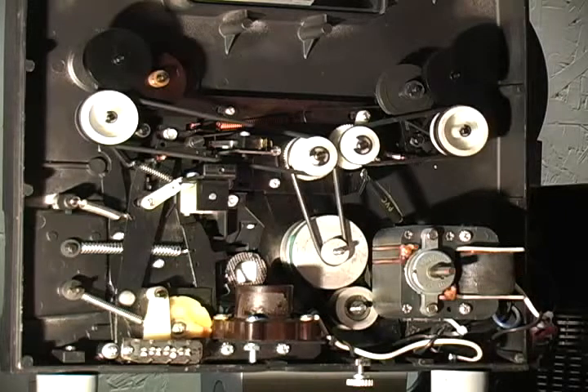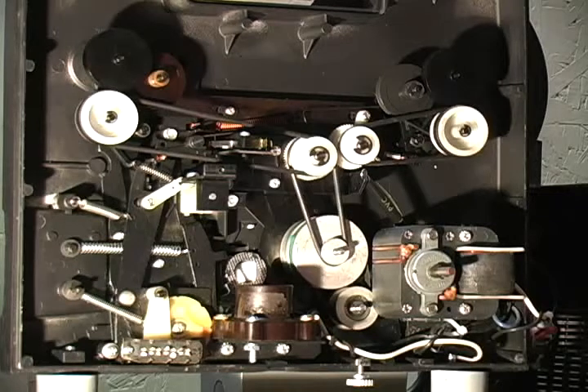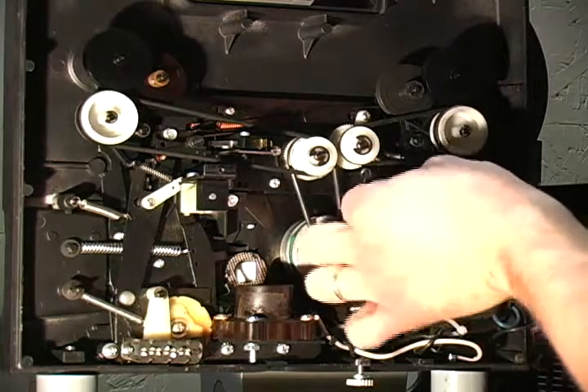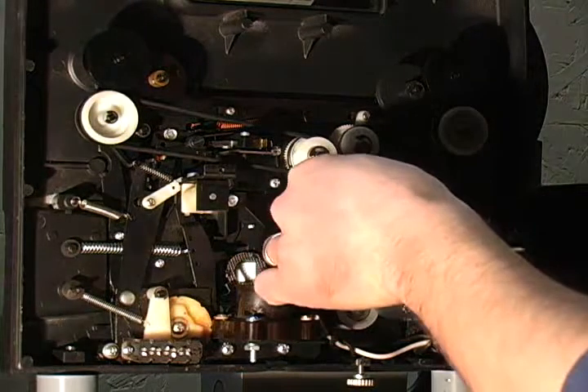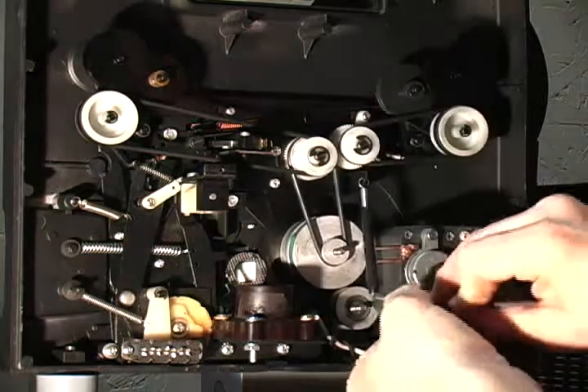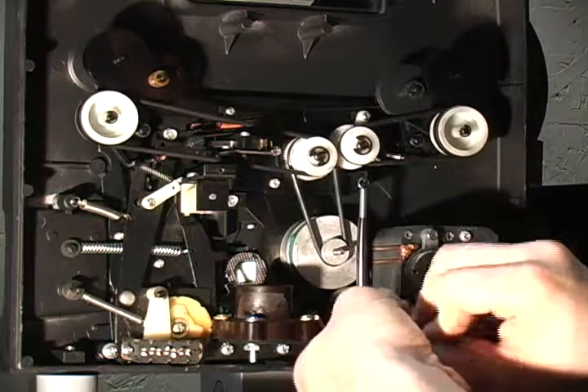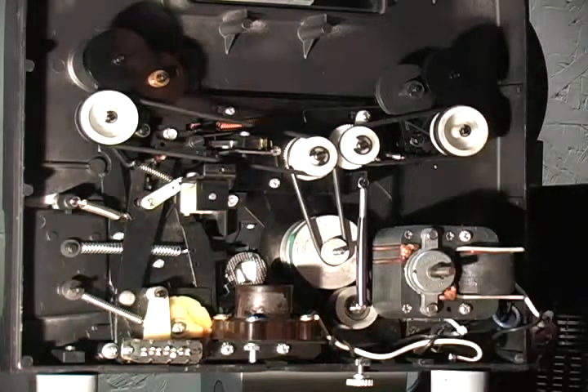If you've seen any of the other projectors out there — some of the older ones, not in the Gaff line or in the Montgomery Wards or Sears line — a lot of those are really hard to get at those pulleys and drive pulleys. This flat belt would take you less than two minutes if you were just doing it without talking through it. Now the last thing we want to do is take this spring — take a pointy object, I'm using my little file, get it in there, bring it down, work it around, and then just release it. That's just holding a little bit of tension. If this spring ever did go, you can buy them at most hardware stores.